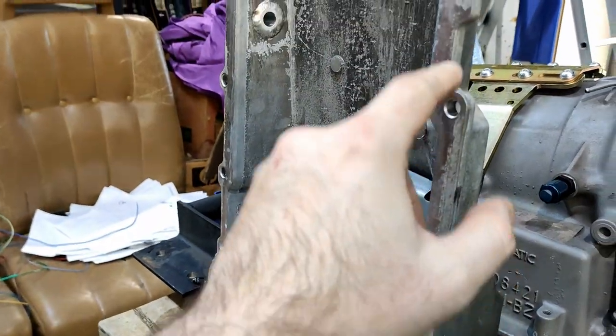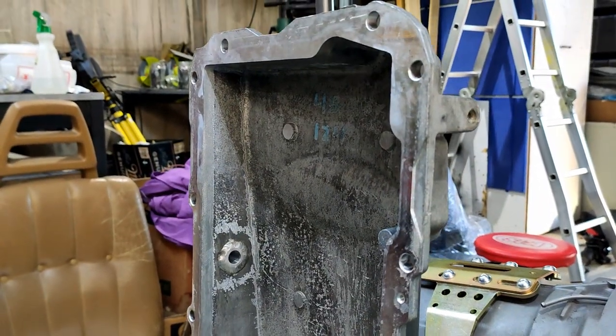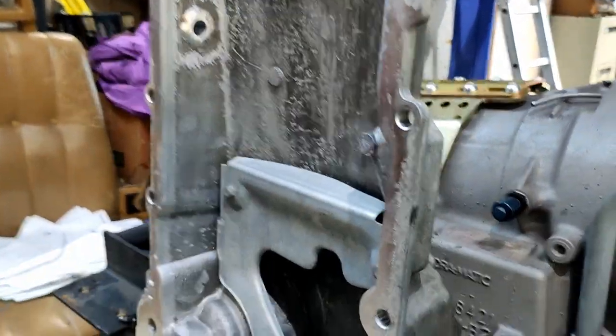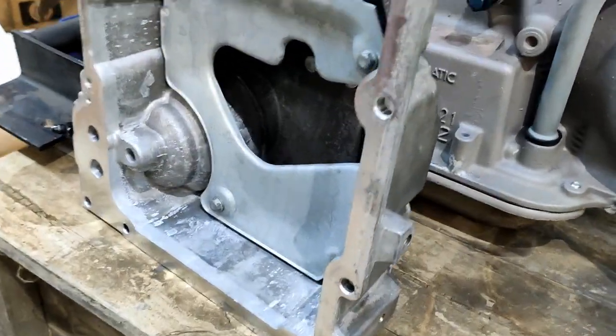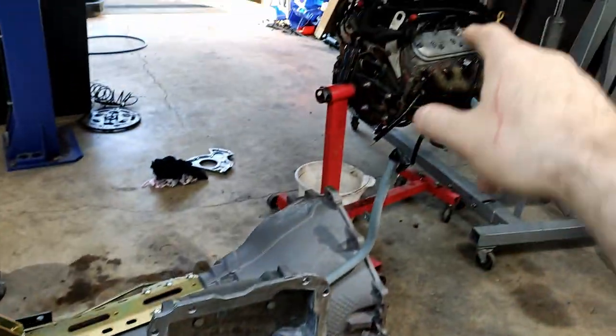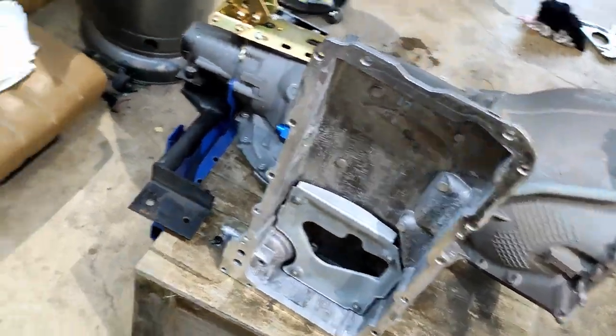I killed the o-ring pulling it off, because it's riveted into the sump, and it was glued in the top here — the more I pulled it, I ended up actually wrecking it. I've got another one of those coming via OzPost, so who knows how long that'll take. I need that and the rear main seal to put the engine back together.